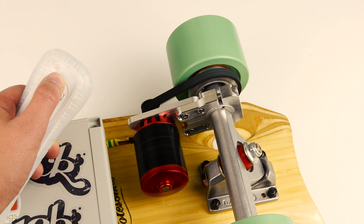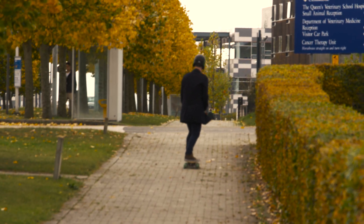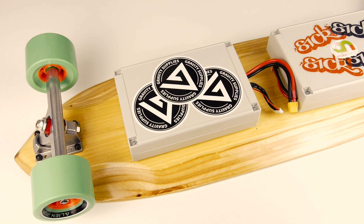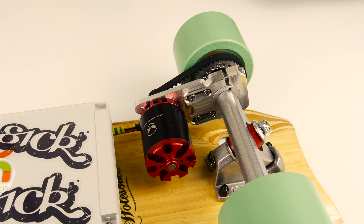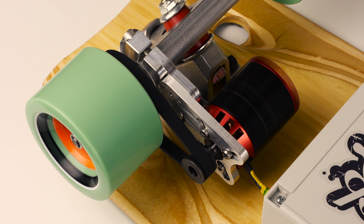This has been a really exciting build and I've been able to get to speeds of around 30km/h on the board, which feels like an awful lot more when you're actually riding it. The board is a top-mounted longboard from Holsom, sourced from a European skate store called Sick Boards. I kitted it out with Caliber trucks from Gravity Supplies and fitted a single 63mm Alien Power System brushless motor — an 80A, 170KV, 3200W little power horse that goes plenty fast enough.